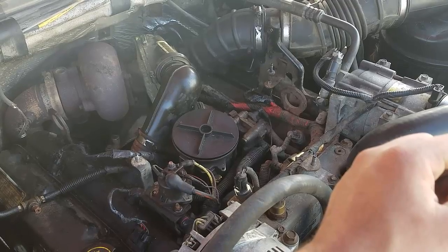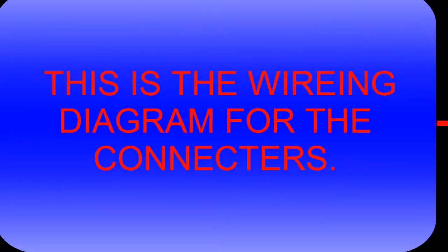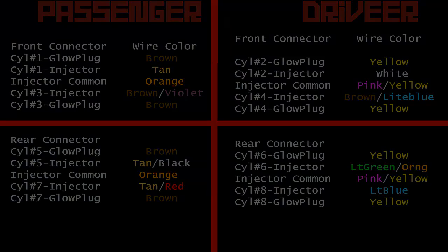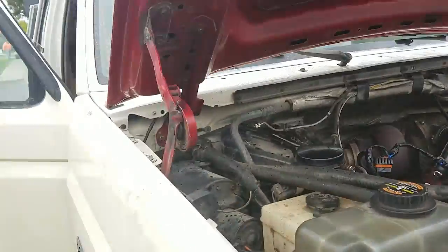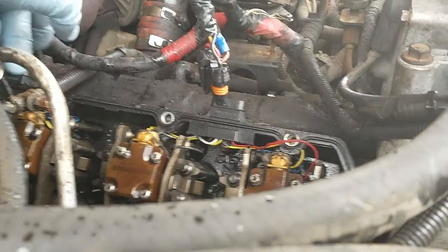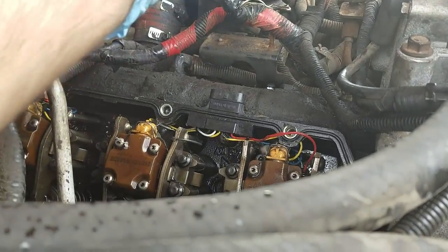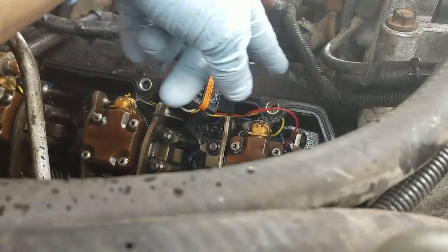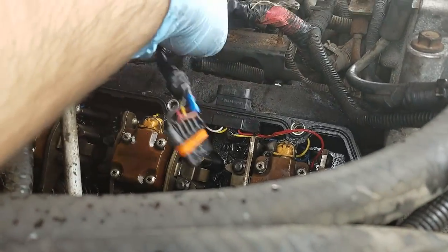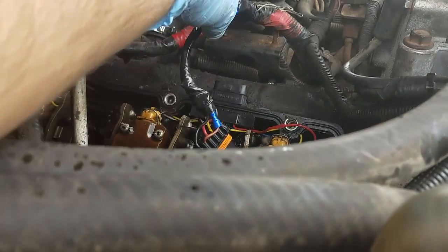I'll be doing this all over again, so I'll come back when this is all done. And we're back with the valve cover off. I didn't need to get a new valve cover gasket, but I will in the future because of a glow plug wire I noticed was a little frayed. The problem was that there was a bent pin in this connection right here and it wasn't getting through. I took this off, checked the continuity of the whole wiring system, and it's good. I plugged it all back up together and was fiddling with it and got it to work. In the future I'm going to replace these temporary butt connectors — I'm going to heat shrink and solder them instead.